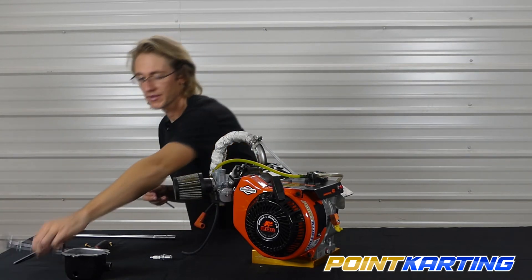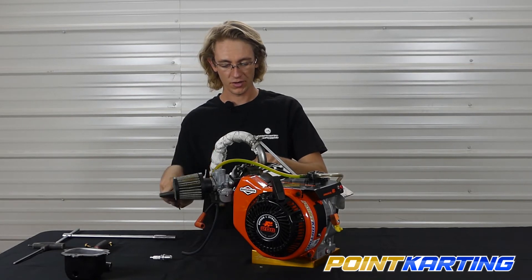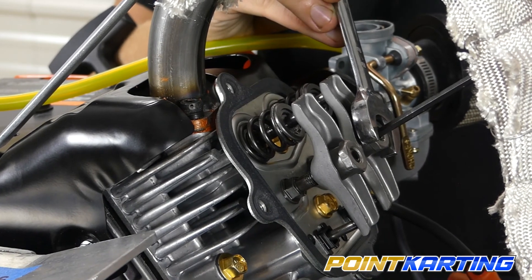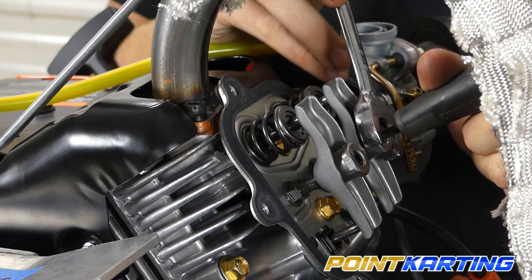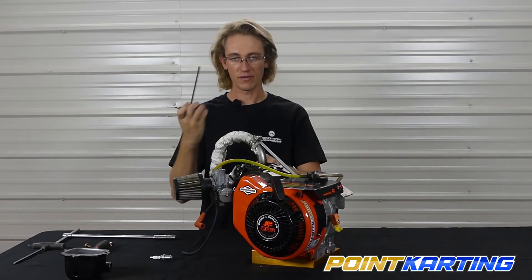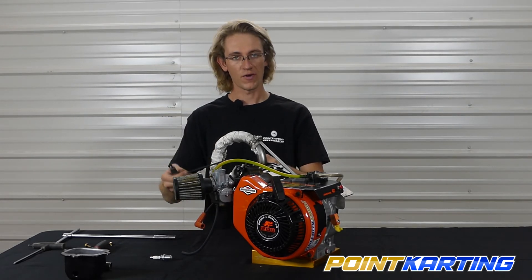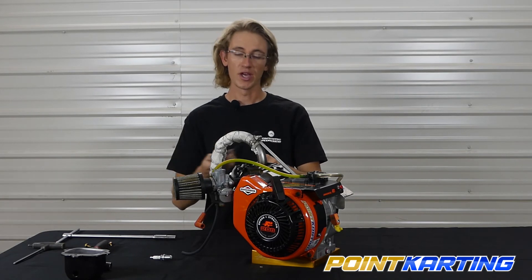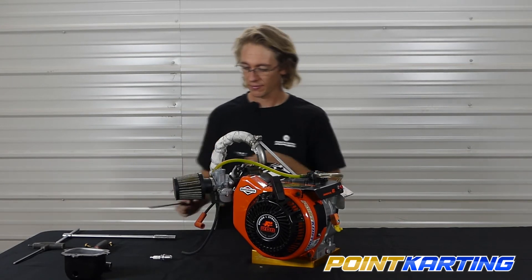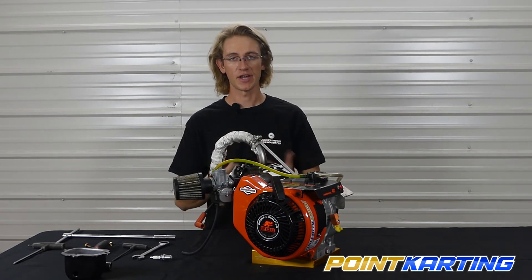To hold that adjustment, use a 5/8-inch open-end wrench around the adjuster and bring your 4mm Allen in to retighten the cinch bolt. For the exhaust valve, I strongly suggest using a ball-end Allen wrench, as this makes getting in there properly tight a little bit easier around the exhaust pipe. You can remove the exhaust pipe, but that's more work. Once this is tightened, check your intake valve, and once you're happy with both, your valve lash is set and it's time to reassemble the engine.